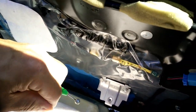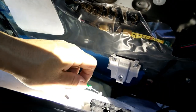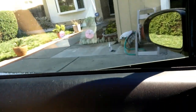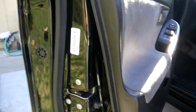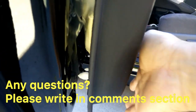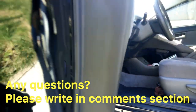Just like in reverse — the white one on top is the actual lock, the bottom green one is for the handle. Once you've got those attached, the door panel hooks on up top here to the window channel. Get that flat and smooth and the clips should line up behind. You can see there are a couple here — they should line up to the holes. Once lined up, use the base of your palm and just snap it all the way around, and that is it.